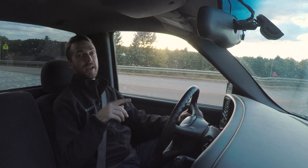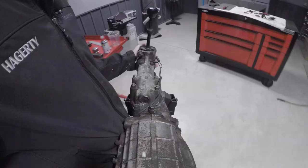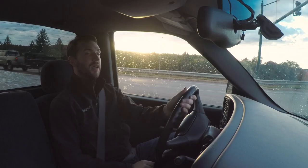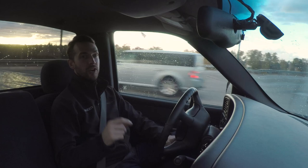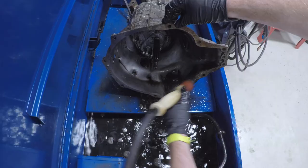So I'm going in - I've got the transmission. I'm going to clean all the grease and oil off of that and get all of the throwout bearing material out of the bell housing. I'm going to sandblast a couple pulleys and a few other little things, and then I will be ready to start reassembly as soon as new parts arrive, which I just finished placing the order on. As soon as that box arrives in the mail, I can stab the engine back in the car and hopefully be motoring soon.